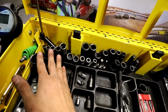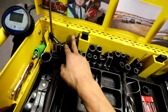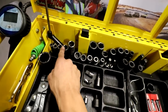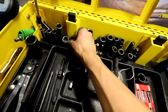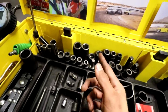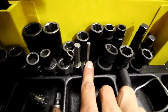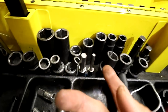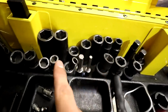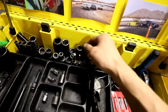Going in the back we have our sockets. I would say deep sockets are going to come in more handy than shallow — that's why I just run the deeps on this rail. These are the sockets I go to all the time, and you really just need a 10, 12, 14, 17, and 19. I recommend having the 3/8 wobbles as well — they make life a lot easier, and they can be a little pricey but they are definitely worth it. Also an Allen 10mm and a 6mm — usually they come in whole sets but these are really the main two you're going to use on Toyotas for the transmission drain plugs.